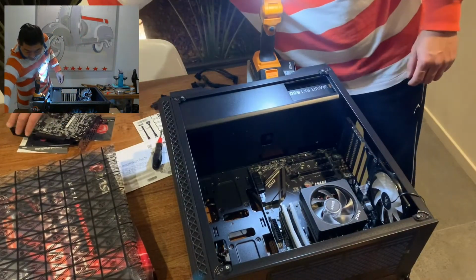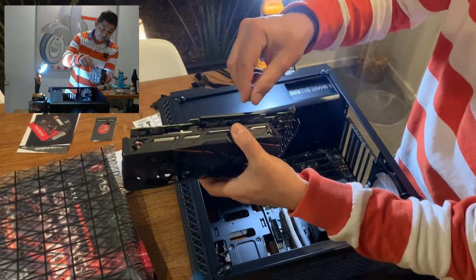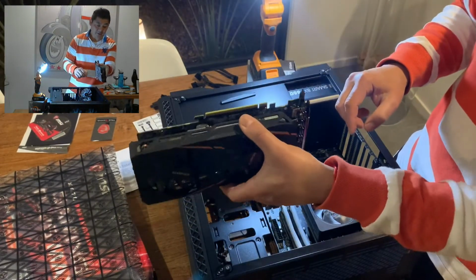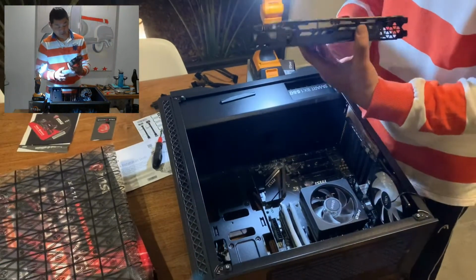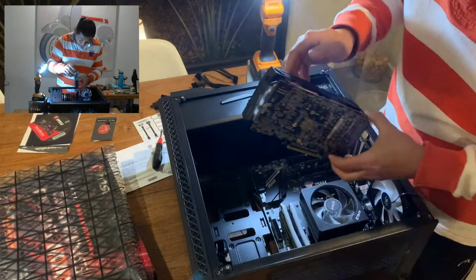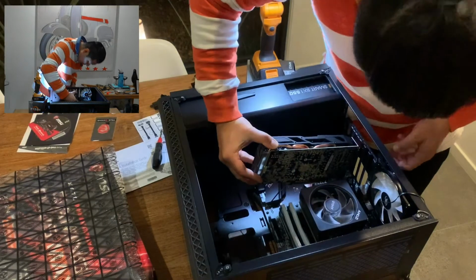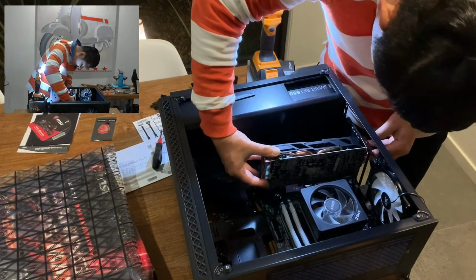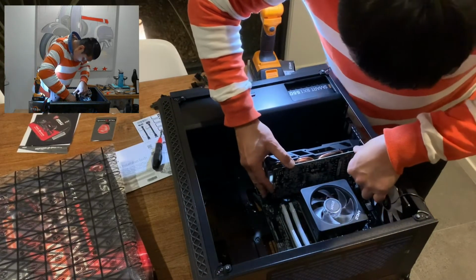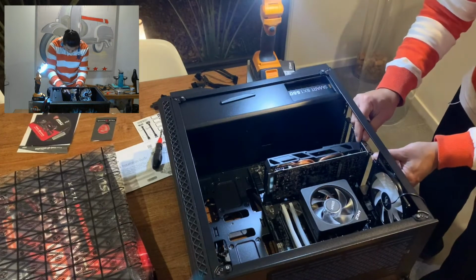All right. So put the graphic card. Actually here there's a protection for the connection, so I'm going to get rid of it. There's a PCIE connection there. I already unlocked the slot, and now with a lot of care, voila, it's in there.